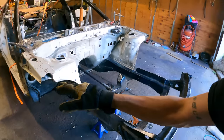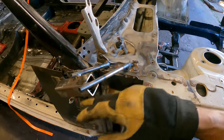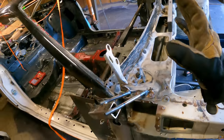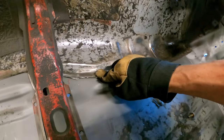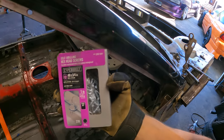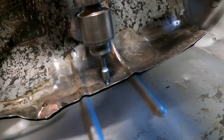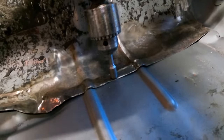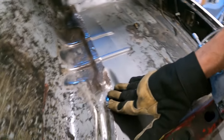If you're wondering why I haven't put the core support on — I'm not too worried about that yet, it's pretty easy to do after I've done so many of them. Knowing that all of these pieces are in exactly the right place is so satisfying. I picked up some self-tapper screws to self-tap these panels flush before welding. I'm going to start self-tapping screws into place so I can start tack welding the car together. It completely removes any gap that was there.